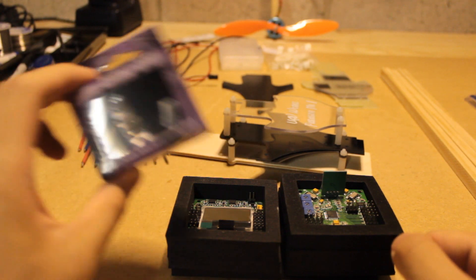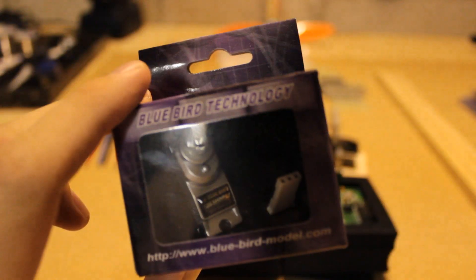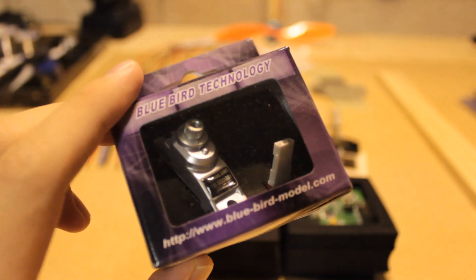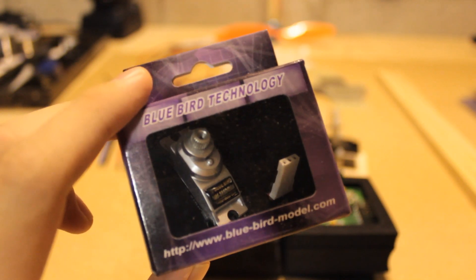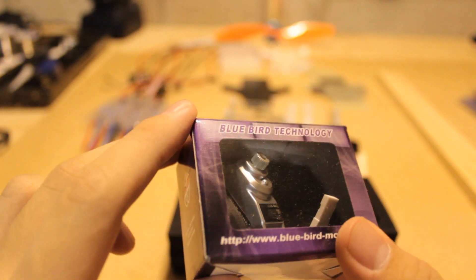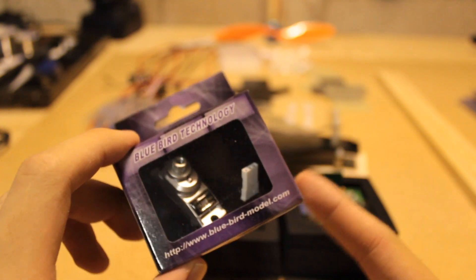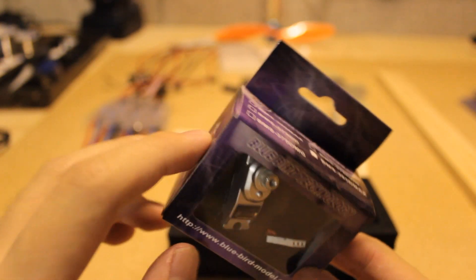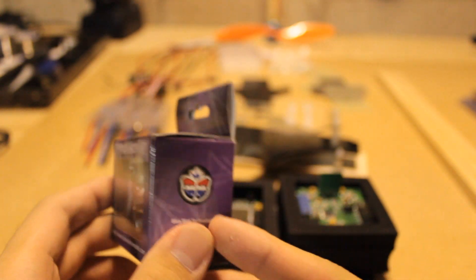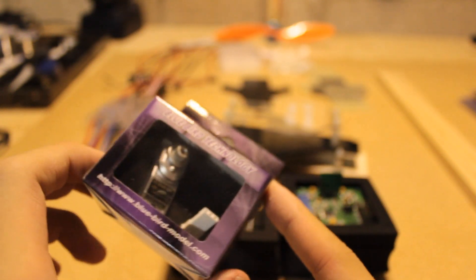The third thing you're going to need is your servo. I would recommend a metal gear digital servo, just because you're going to be straining the servo a lot from your yawing. I would not recommend nylon gears or the nine gram servos — you're going to wear those out very quickly. The yaw is an important part of the tricopter so go with something more expensive. This will be linked in the description below. It's about $20, but trust me, you really want a good metal gear servo.